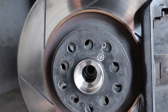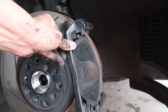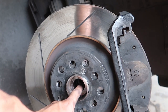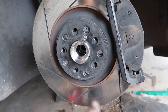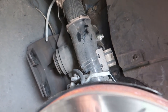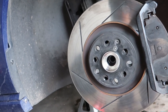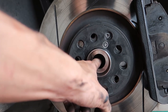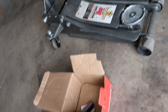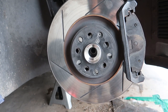I've got most of it back together. Torque specs: hub bolts are 52 foot-pounds; the big bolts in the back of the caliper carrier are 147 foot-pounds; axle bolt is another 52 foot-pounds. I'll look up the control arm bolts and type them on screen. Everything goes back together the way it came off. I'm going to use the old axle bolt first to pull the axle all the way in, then swap to the new bolt — which already has loctite on it — and torque it down. Then I'll clear the codes, go for a drive, and hopefully this is fixed.